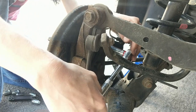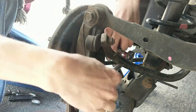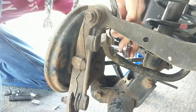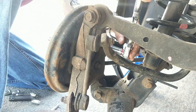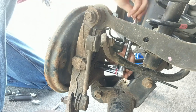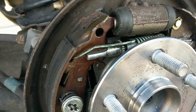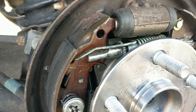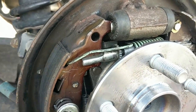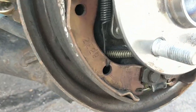When tightening these bolts, you'll want to do it in a star pattern. To reassure yourself that you've tightened them enough, you'll see that they poke up through the hub itself — you can see how this one is poking out now, as well as the other three.